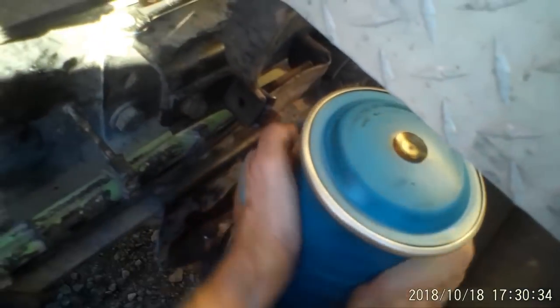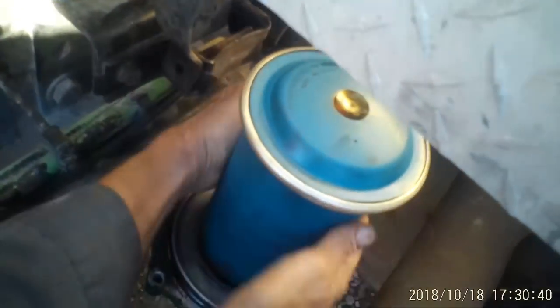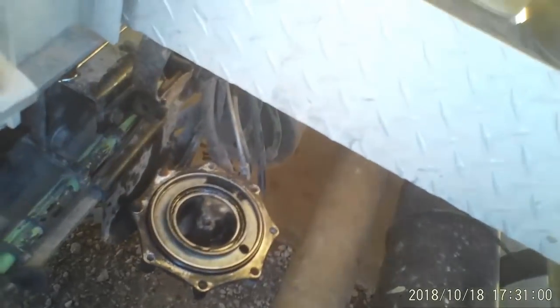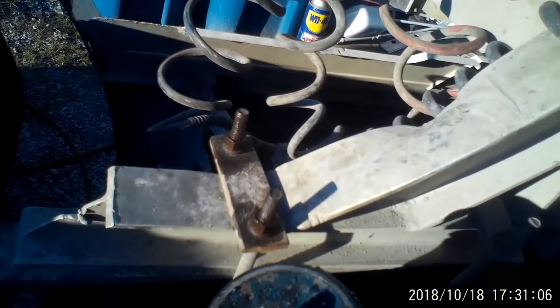And if you're taking this thing off before you buy the new one, be sure you take care of this piece, because this is one of those things where the core is worth more than the replacement part. So all they do is clean out the, what you call it in here, those little beads, desiccant. See all that oil in there? That contaminates the desiccant. And a lot of oil is usually from a bad compressor.